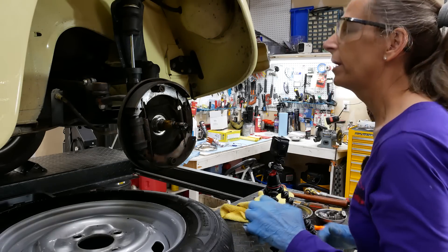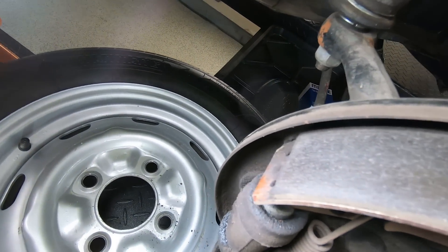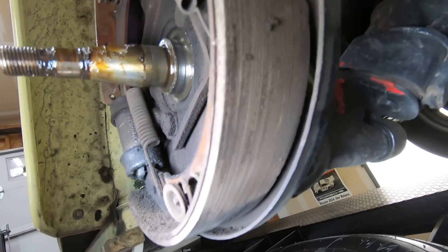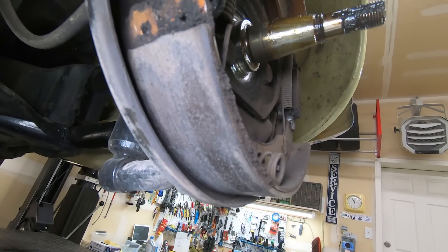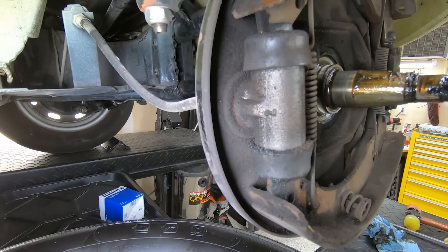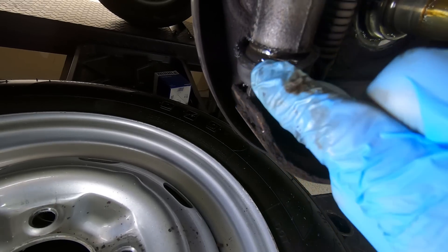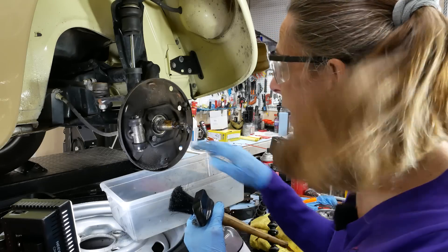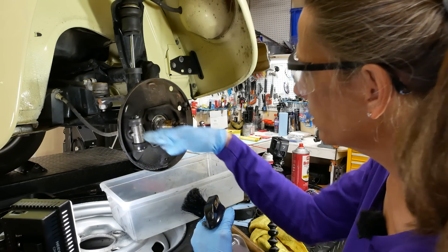What we're seeing is a little bit of schmutz down here, and it's quite probable that this wheel cylinder is weeping. The bottom of that shoe doesn't look great either. The top shoe is nice and shiny, clean and dry — that's good. But look at all this schmutz and grease down here, and the crusty buildup on top of that gasket. It's all wet inside. That tells me this wheel cylinder is weeping, which explains why this wheel isn't working 100%.